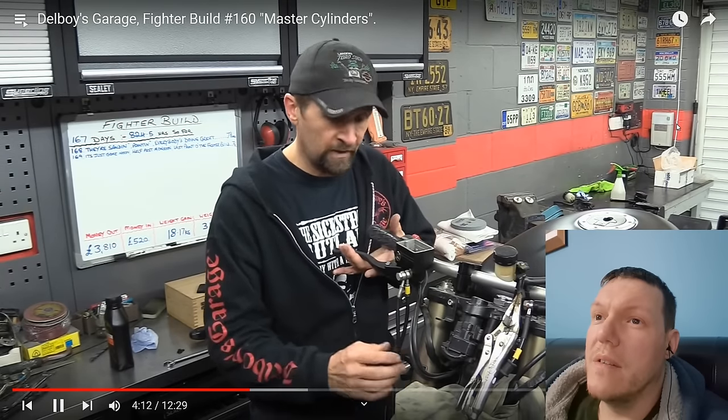That looks like you're going really far back there. That's the sponginess of the lever. At the top, there's no need to pump that down the system and bleed it out through the calipers, risking trapping air bubbles lower down. You're not going to trap them. It's designed... ending up with a spongy brake operation, which is not cool. That looks spongy to me. If it's solid to start with, all you need to do is put it on, pump it in and out once it's done up, and the air will come out the top.